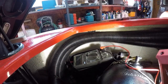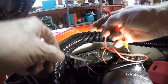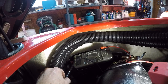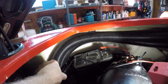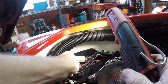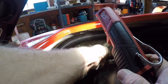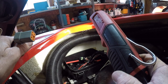All right, I had a spare connector. So I'm just gonna plug that in down there. Just hook onto here, see what we got. Nothing coming out of that. Zero. But that would, you know, this module is toasted. Then we wouldn't be getting any power to the computer. It's just back feeding through the bilge pump right now, powering the computer. Outside of that, we're getting nothing.